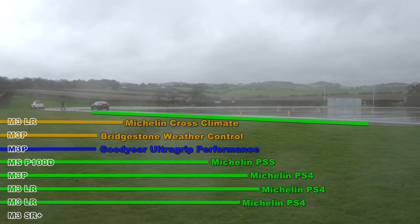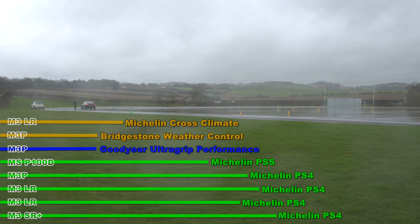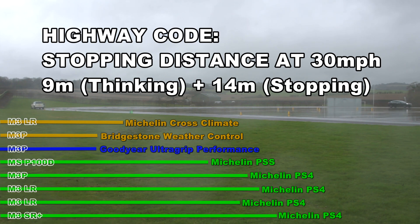With all our cars completing the test, we can see in relative terms from these graphics how the summer tyres are a lot worse than the blue winter tyre or the orange all season tyre. But what does that actually translate to in terms of distances? In the highway code, stopping distances are given at different speeds. They talk about the thinking distance — the time it takes to see the hazard and hit the brake pedal — and then the actual stopping distance, and they add those together. Because we used a cone as the point where you press the brake pedal, we don't need to worry about the thinking distance; we're just concentrating on the stopping distance.